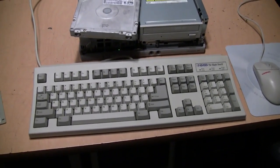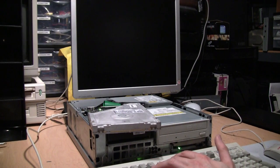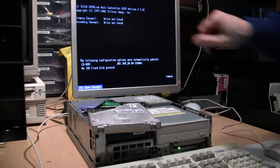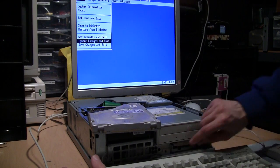Let's see what happens. It's making that bonging sound again. That other one is just a SATA controller so it's normal for it not to indicate anything. But it says 'No IDE fixed disk present,' which is not promising. It's not recognizing the hard drive — just shows the CD-ROM drive and what's actually a DVD burner. Let me try powering it down and turning back on.